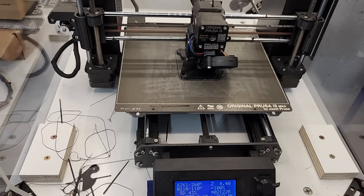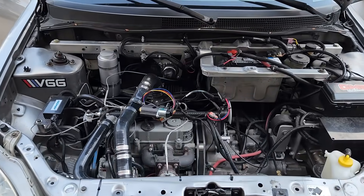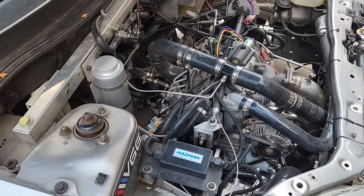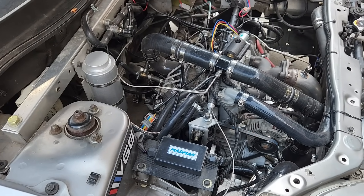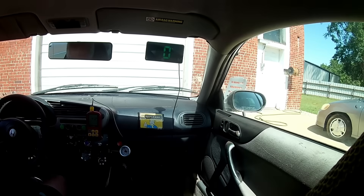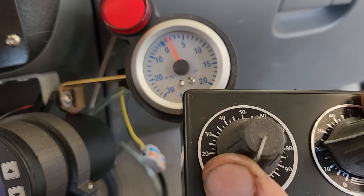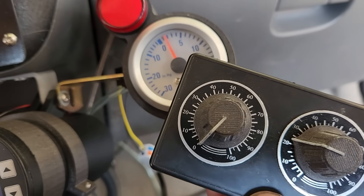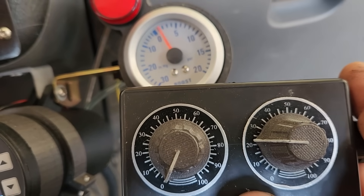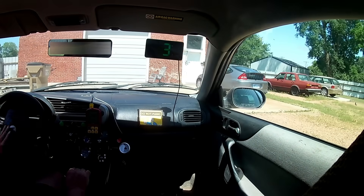At some point I did do a little work, and the car was reassembled. After letting the car run for about a half hour, we checked for oil leaks and discovered the rack limiter gizmo was not letting any oil escape the engine, which is awesome. So with the rack limiter and the boost controller installed, it was time to take the car out for a road test. The next concern is whether the rack limiter will actually limit the position of the fuel rack. We'll set the limiter to zero, which should theoretically limit the fuel rack to factory specifications and result in quite a bit less power.